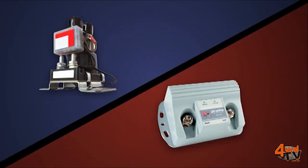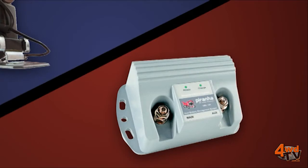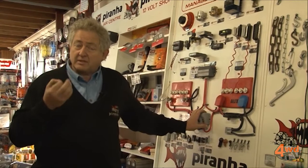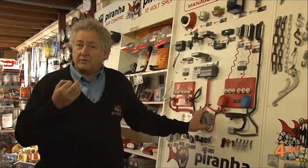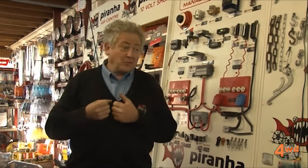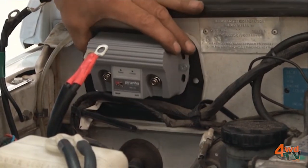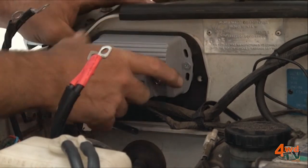Do not be fooled. The difference between a smart solenoid and an intelligent battery charging system is that a smart solenoid only controls the predetermined switching of voltages. In an intelligent system we have current limiting, which is an alternative to using a fuse or circuit breaker. A fuse or circuit breaker blows very slowly in electronic terms, so the computer or electronics will be damaged before the fuse blows. It will protect you against a fire but not against a surge or spike. A smart system actually turns off the load very quickly, therefore protecting your vehicle's electronics.